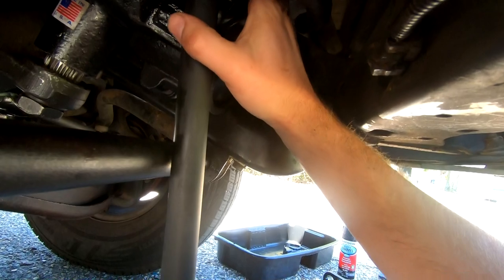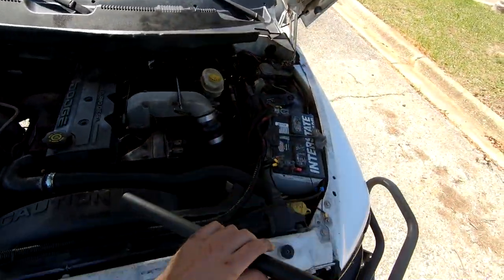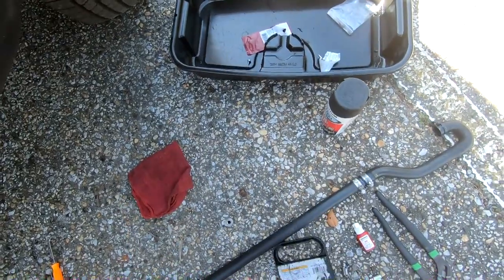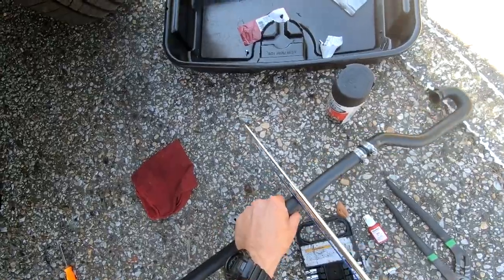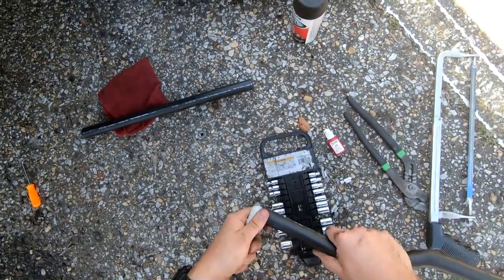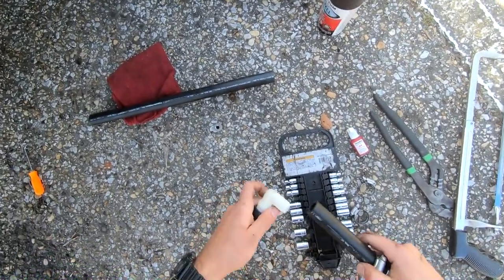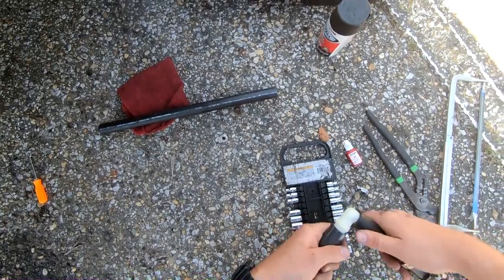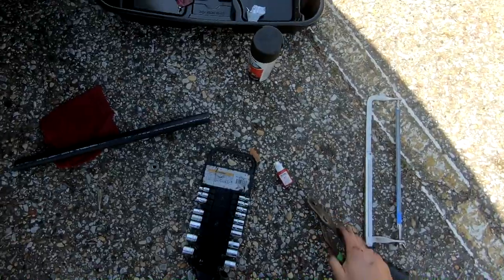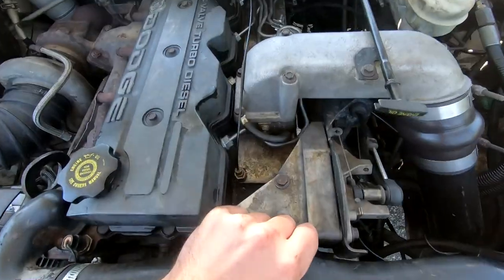I got a mark right about here — I put a hole in it so I know where to cut it. Let me go ahead and cut this with a hacksaw and then shove in our angle piece. It leaves a lot less tube than I thought, but it is what it is. I'll go ahead and grab the elbow piece, put it in, and I'm not tightening the hose clamp yet because I don't know exactly what angle this has to be at. I'll leave it loose so I can still rotate it as needed.